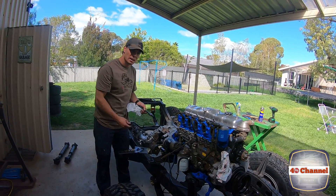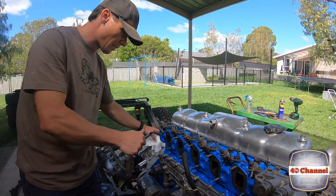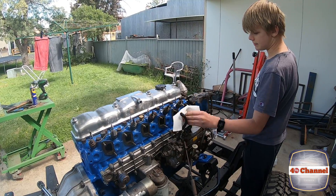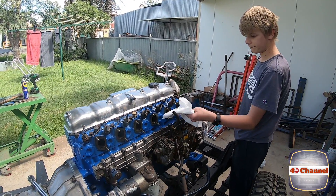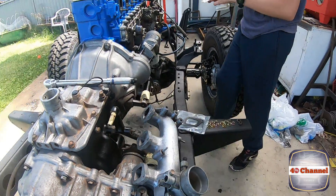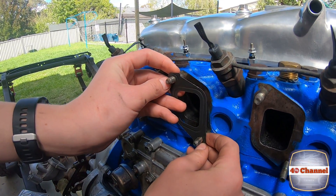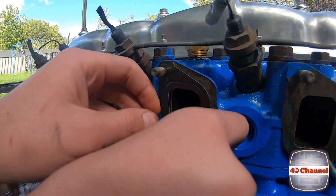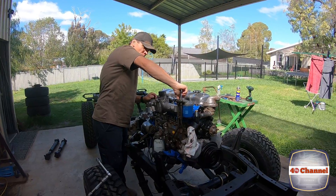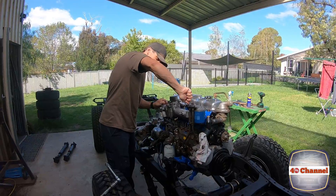Some of these studs are a little bit rough, so we've just got an M8 die and we're going to screw that on the end just to clean up the thread. Jack's making sure that all the surfaces are nice and clean — no bits of dirt or swarf left on them — so we have a perfectly clean surface on the block. All these surfaces are clean and ready to go. With a new gasket set, Jack's going to put the gaskets on, carefully working them on. There was a tiny little ridge on the gasket so we're just going to compress that, working our way along the steel gasket.